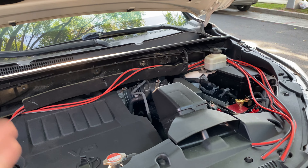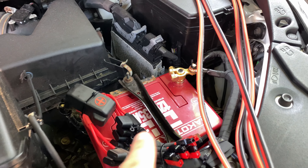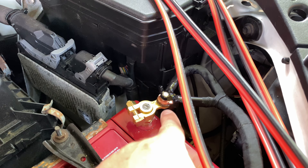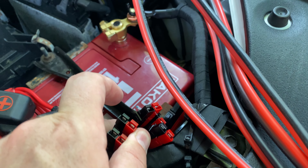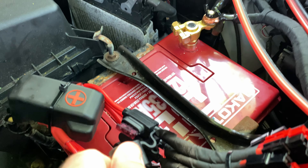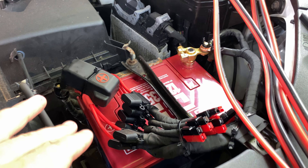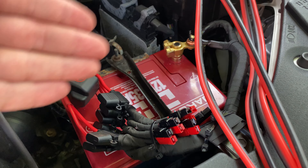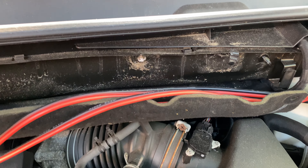Welcome to my wiring system for the car. Last time I installed these new terminals using M8 5/16-inch connectors creating Anderson plugs — each has a 40-amp automotive fuse. This taps directly into the battery, which gets fed by the alternator. The battery itself has 1.5 kilowatts of energy.